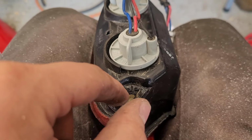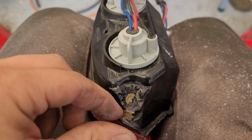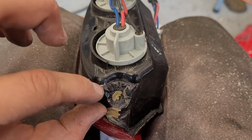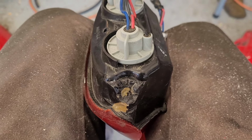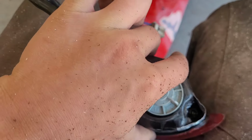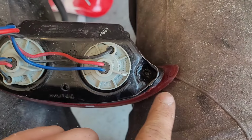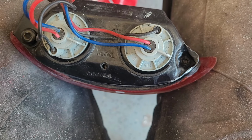So I'm just going to go through, clean up all this plastic with the grinding bit or the burr. We'll tape it off and just fill it on up with Plastifix. By the end of this, this bike's pretty much just going to be Plastifix. So here's that form I'm talking about. Very simple, and it should hopefully make something similar to that. So I'll just go through, same process, powder, liquid, repeat.